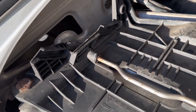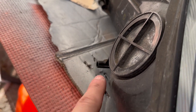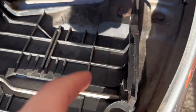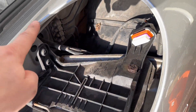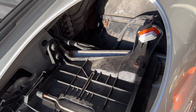When you reinsert the headlight, you're going to insert the tabs on the headlight at the front and back into those guides. It could be a little bit of a faff to start with, but you're just making sure the headlight sits flush and equal all around. Then you can push the headlight in and secure the latch to lock the headlight in place.